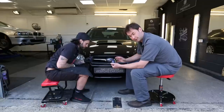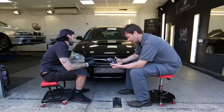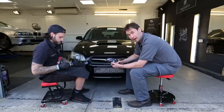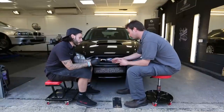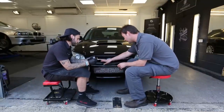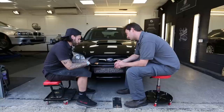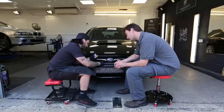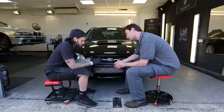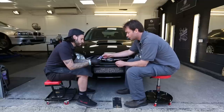You'll often see this marbling particularly along rub strips on trim. It's going on nicely and consistently — quite often they can be a bit patchy. The key is to get a nice even spread and do the areas you can't initially see, such as plastic on the verticals. It's being applied here just with a little suede cloth. It's definitely making a darkening. The marble effect is still there — it might be worth doing a second coat. With all of these you put them on, wait for them to go, where the solvents vape off, and then you buff them again. Not too bad — a second application would be good to darken it a little bit.